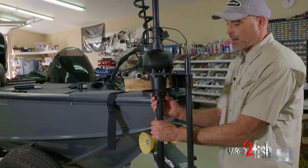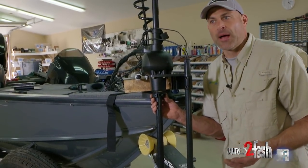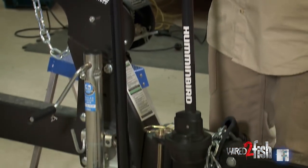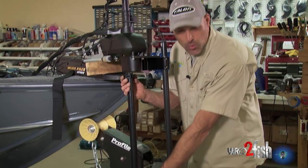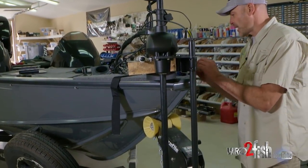If you're going to go fishing in shallow water, you'll need to loosen these two Allen screws and raise everything up, keeping in mind the orientation of the pod as well as the height — making sure it remains one inch above the top of the propeller. With that in mind, we're going to mount this collar on the shaft.